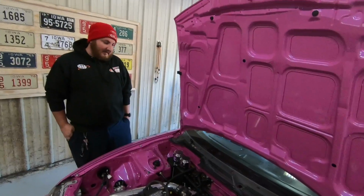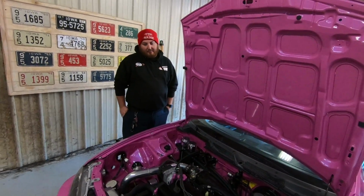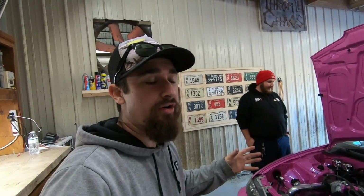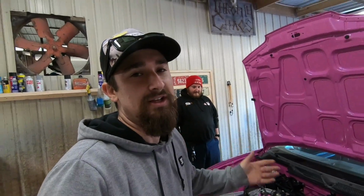Right. So there's still a couple of things that we need to kind of go through, but, you know, we're getting there. And I always stress that I do not like buying cars that have been previously modified, and that's a prime example. Someone went through and tried to do something that they thought was going to be real cool, real nice. I want to paint the starter, but they're not keeping in mind the function that it has to do. It still has to be grounded. No matter how nice it looks, it needs to be grounded.